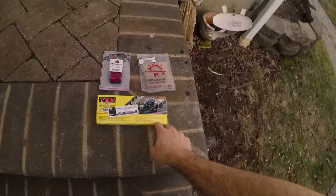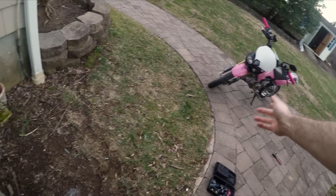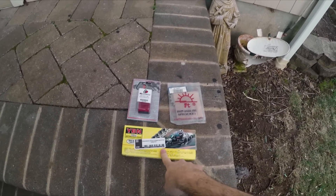As I was telling you guys in the last video, I had a few things coming in the mail that I wanted to get for the 50 in order to make it perform a little bit better. The first thing is the chain, because by increasing the sprocket size, you're going to increase the amount of chain you need. This one I'm already adjusted all the way forward, so there's no more adjustment left. I need a new chain, or at least a few links, but I'm just going to use a new chain because I might as well.